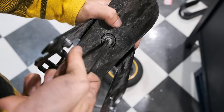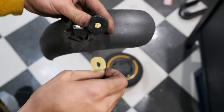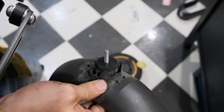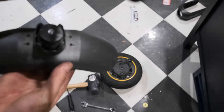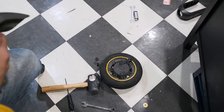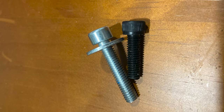Here is the front fender. There is only one screw to remove from the original fork, and you will find a sponge-like sticker from the kit that sticks in between the fender and the suspension itself. You can screw the fender onto the suspension, but I didn't do it because some people in the Ninebot community say the wheel can stop from hitting the fender and risk safety. So I do not recommend putting it on. But if you want to install the fender, make sure to use the shorter screw provided by the kit.